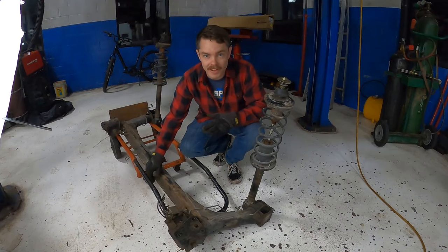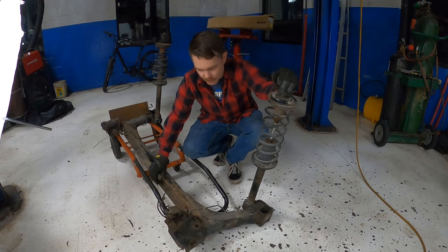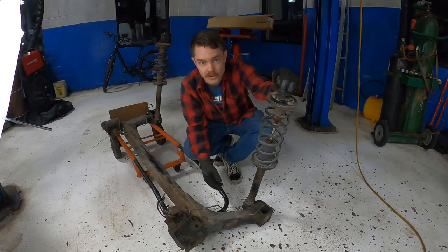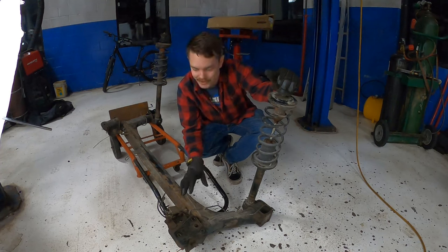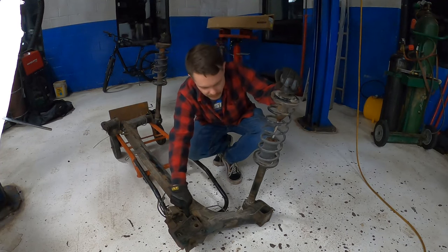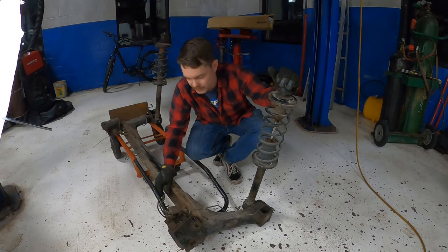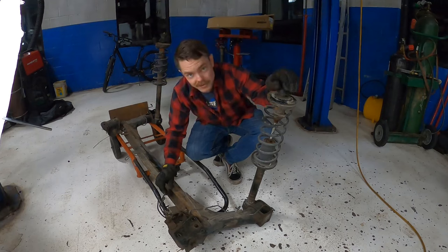All right, to get that brake line taken care of, I pulled the parts axle out of the shed over here. I think these brake lines here will kind of swap over directly. We're gonna try it, but they're a little bit crusty, so I wanna get a little heat on here. We're gonna get the oxyacetylene torch out. I've never used one of those, but heard that might be the solution tonight. Let's give it a shot.